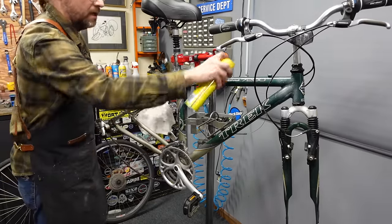So this brake feels loose — it's got really good tension and amazing feel, but it's loose. So we're going to tighten the cable a bit: loosen the anchor, pull it through, and that's pulled through tight. I'm going to back it off a smidge — I feel like that was too much. Okay, maybe it was good — smidge, there we go. And I'm not tightening it down a ton because I want to be able to make micro adjustments as I go.